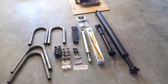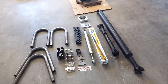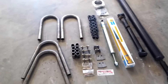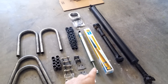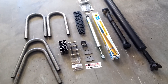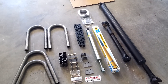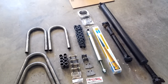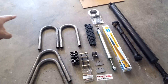To do that, the front will require a 14-inch travel shock. I ordered some new shock hoops for the front — those are for the front — and there are the 14-inch shocks for the front. I already have 14-inch shocks for the rear. Hopefully those will be long enough because I also have a revolver shackle on the rear, so I may have to go to a 16-inch shock.